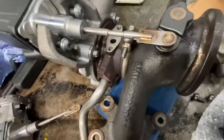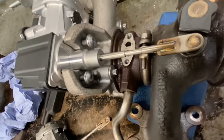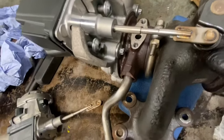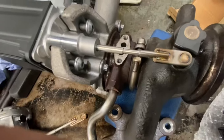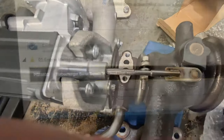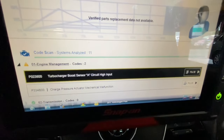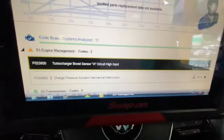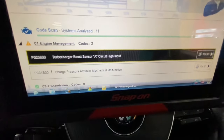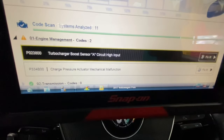There you can see, I've fitted it back on. Now I'm going to do the bolts up. Literally slot that in first. I'm going to tighten the bolts up now, and then I'm just going to put the little circuit connector underneath there. I've put the new bolts in. You can use the old ones if you haven't got new ones. These are the fault codes that were on the vehicle before I actually replaced and changed the boost pressure actuator. So if you see these codes, you'll also have to do your own diagnostic to find out exactly what's going on. Don't always just change parts because of fault codes.